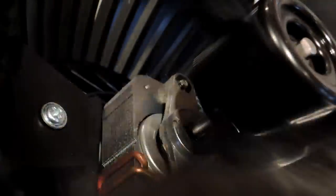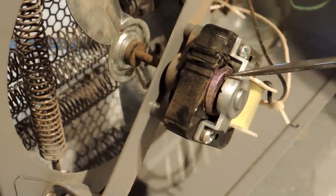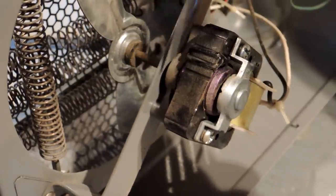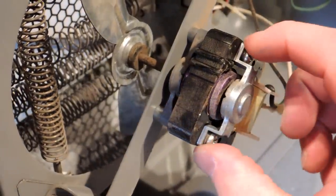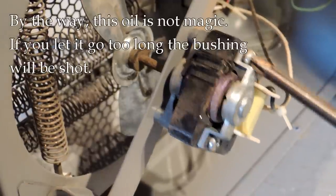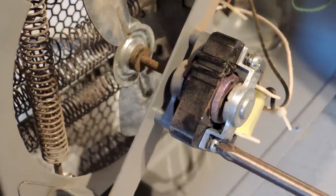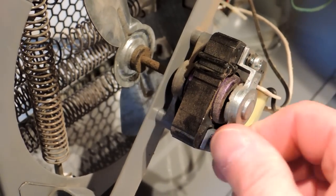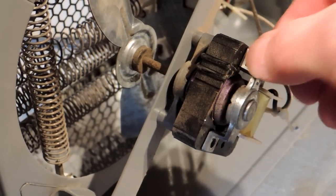For the heater I could drip some oil in from the back to reach the back bushing, and drip oil in from the front to reach the front bushing — that's probably all I need to do. But I noticed this particular one has a small bracket here and I should be able to get the back bushing off. Let me just take a Phillips screwdriver and see what I can take apart here.